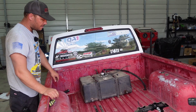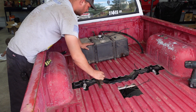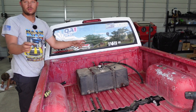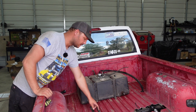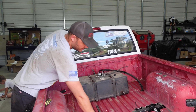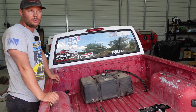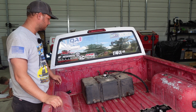I'm not exactly sure what I'm going to do. What I'll probably do is build two straps, connect them, and make it where there's a bolt out here and a bolt out here — put little ears on them so they reach out a little bit. That might work better. It would be nicer for welding or bolting on here, and these will just get placed underneath. Bolts run through, and next time we put the truck on the lift we'll tack these onto the truck so they don't move. If we ever have to take the fuel cell out, just unbolt it from the top and you're done. So yeah, we're going to run to Home Depot. We might pick back up on this today, or I might wait until tomorrow because it is raining and the shop's getting kind of loud.